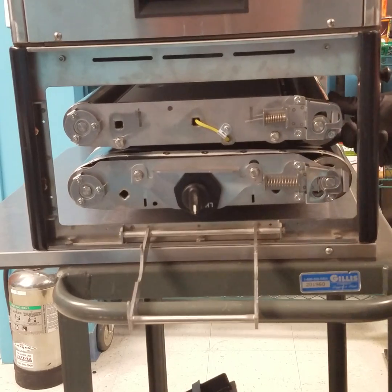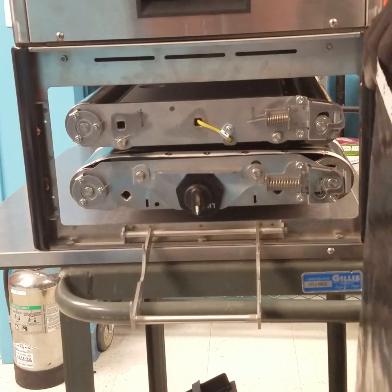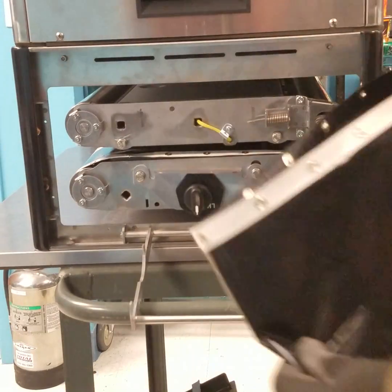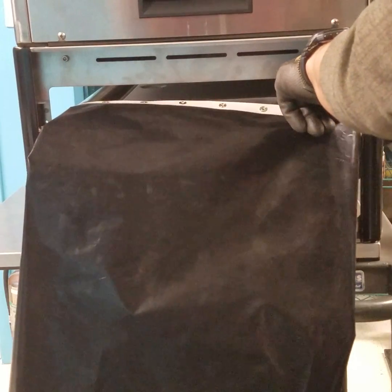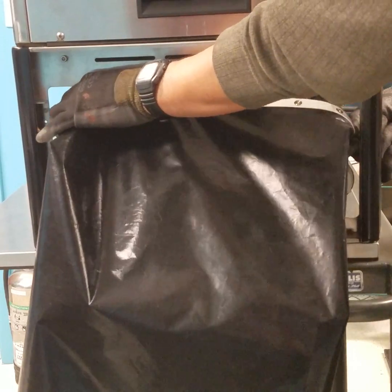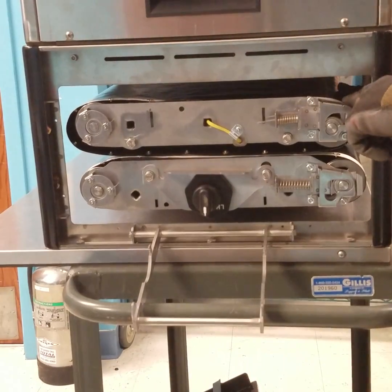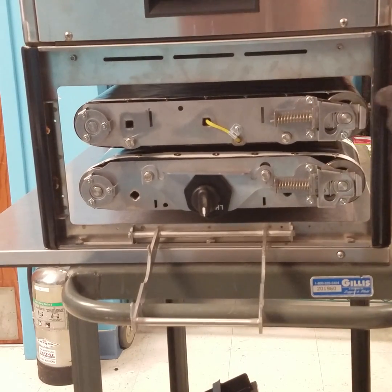Reconfirm that your rear top idler roller is still in the compressed state at both ends to facilitate belt reinstallation. The belt can be installed in any direction. Start at one end and gradually rotate it as you push it towards the opposite end. With the belt installed, pop the roller up to spring back at both ends.